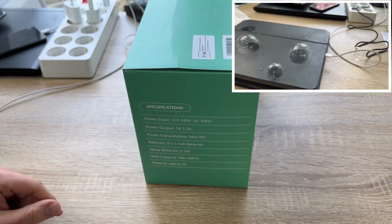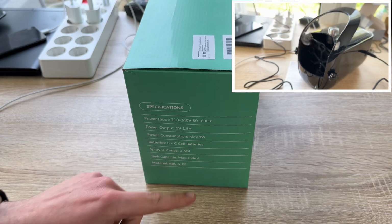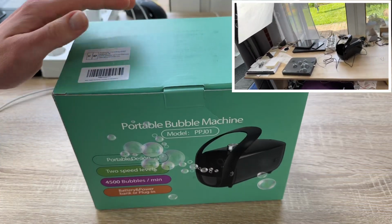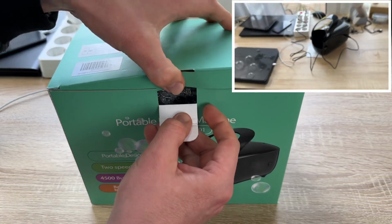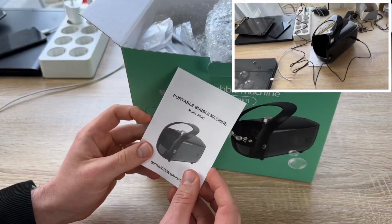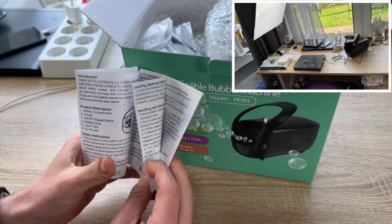If the bubble machine is to be mounted using a bracket, we should note that the machine should only be inclined to a maximum angle of 15 degrees, and the bubble machine should not be used for more than 8 hours consecutively. It is best operated at 40 degrees Fahrenheit up to 90. These are 4 degrees Celsius up to 32. Performance of the machine may be reduced in low temperature areas.